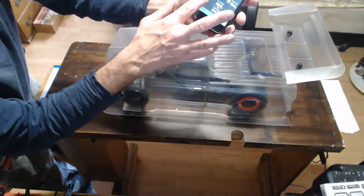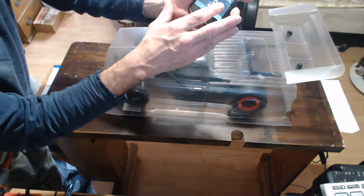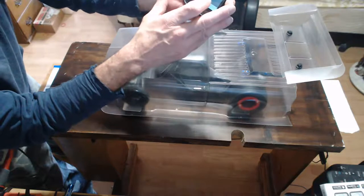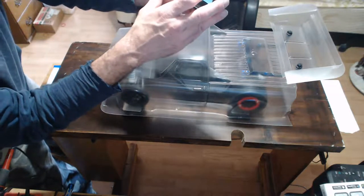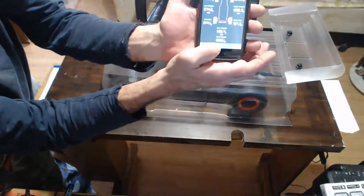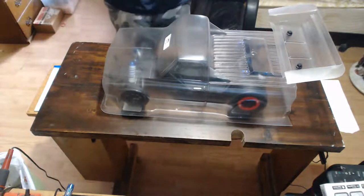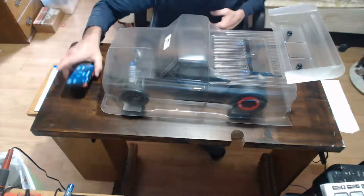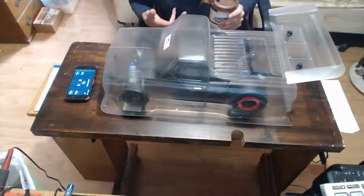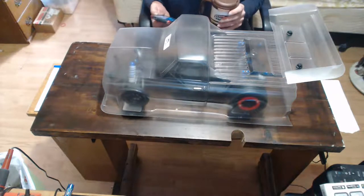The rear: 644.1 on the left, 730 on the right. The rear weight ballast is 1381.2 on the rear for a total of 70% rear weighted. Total overall weight is 1980.1 grams — that leaves me under the current limit of 2050 or 2060 grams. By the time you throw paint on here, that will add a little bit.